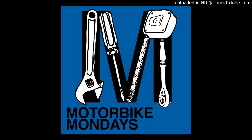Nobody ever explains exactly what a burnt valve means. Looking it up — a burnt valve is physical damage or disfiguring of the valve, usually from heat on the exhaust valves. The physical damage is to the outer diameter of the valve, mainly from exhaust gas escaping around it — it overheats and actually damages the outer diameter, preventing it from sealing to the head.